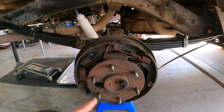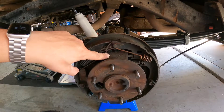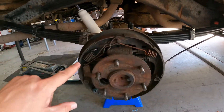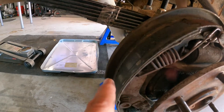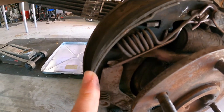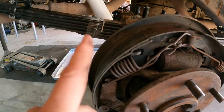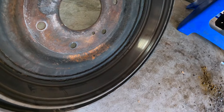If you look right here in your rear brake, you see that little groove there and those rivets? It's not supposed to be like that. There's really no meat left on these pads, so it was metal on metal. See those two grooves in the drum? Those aren't supposed to be there either. That's why I haven't been driving this even though I have the fuel injection kit installed — this is not safe for the road and I don't want to put my life or anyone else's at risk.